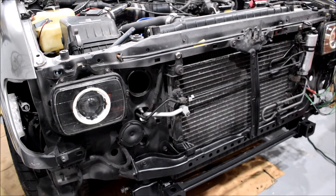I did replace all those components as mentioned, and the reason you haven't seen an AC video until now is that after doing the o-rings, dryer, hoses, compressor, and expansion valve, when I went to charge it I still could not get the clutch to engage at the compressor — which means it's not getting power. I know the compressor itself works because I can jump the clutch over to the battery and it will engage. So it seems the issue is an electrical one. You could argue I spent a lot of money refreshing all these parts when it was probably just an electrical issue — which is why I also ordered the amplifier, the thermistor, and the pressure switch.